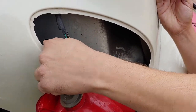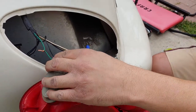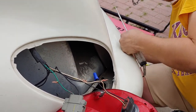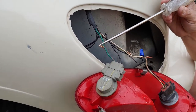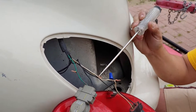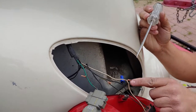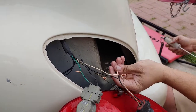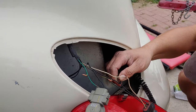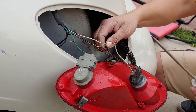Because this light has your yellow — your yellow is going to be your blinker — we know this top section goes to your blinker. You have ground and you have your power. Usually black is your ground, but I always double and triple check it because I don't want to be plugging things in without being 100% sure. So if I go in here, there's my blinker. If I go in here, there's nothing. And if I go here, there's my running light. This is my running light, this is my blinker, and then this is my stoplight. I've already tested — this one is black, which is ground. If I undo this one, you're going to see — and you always want to make sure you don't touch anything, so I just hold it. If I put this here with ground and come around and touch this, it'll come on. That's positive, that's my ground. So this is confirmed it's ground.